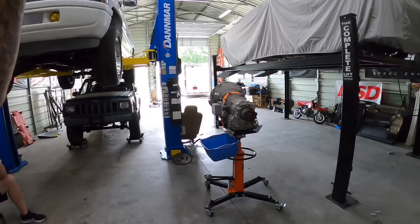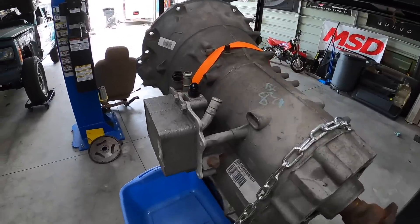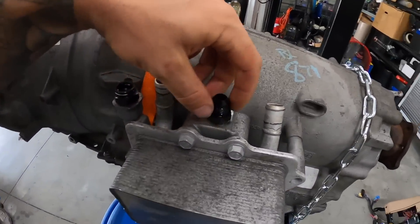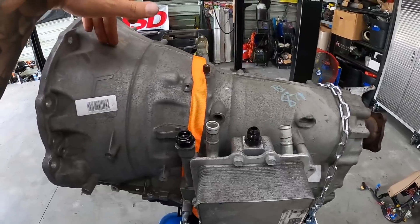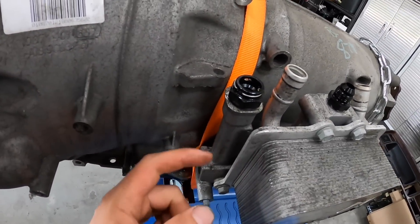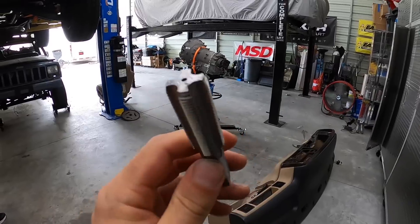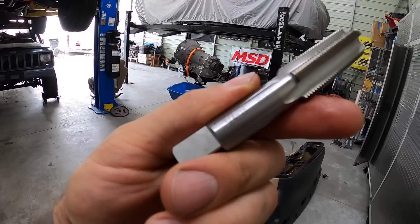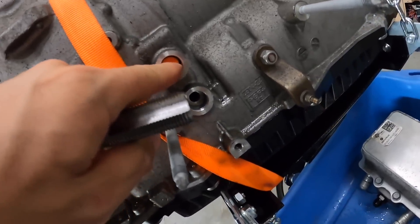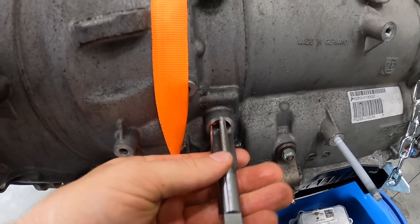It's the next day. We got Dennis over. We are going to take off the oil cooler heater box. I picked up the correct size tap so we can put fittings in here. The transmission is up on the transmission hoist. I've got the correct size tap — it's a three-quarter dash 16. Dennis' idea was to use a squishy ear plug to block the port, and we'll tap it out and put our fitting in.